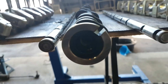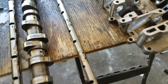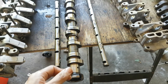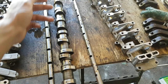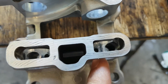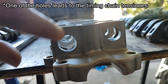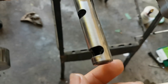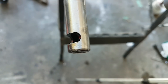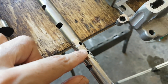There's a bolt that usually goes here to seal the camshaft — because the camshaft is hollow — so the oil doesn't just come out. The oil also goes to all the bearings via the second path: there are tiny holes in the gallery, and from those holes the oil goes to these two shafts that go in here. The shafts are hollow too, and the oil flows into the shaft through a hole and comes out through small holes along the shaft.